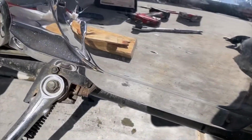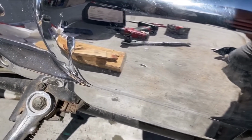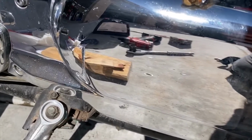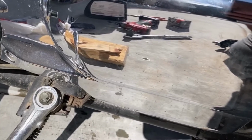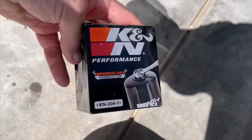It takes 3.9 quarts when it's fully empty. That's with the oil filter and draining out all the oil. And it's pretty straightforward, 17 millimeter. And then make sure you get K&N. This is the filter you need. K&N